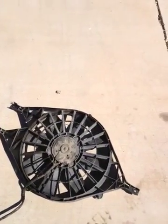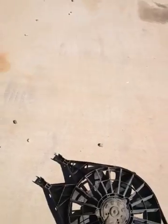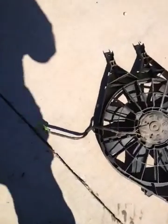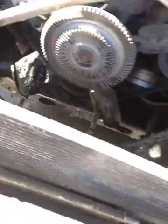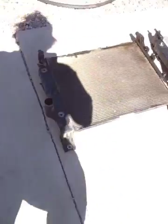I'm going to walk over here to the old radiator. There's the fan. It came off of there. I had to get the fan loose. The wires on mine were running up through this hole here, and this shroud was up against it, where I couldn't get the sensor out, so I had to loosen the shroud just to get the wires to the fan. And of course we had to loosen the two tubes that go to the coolant for the transmission.